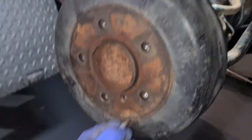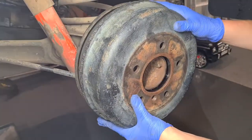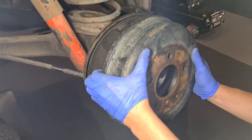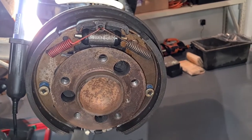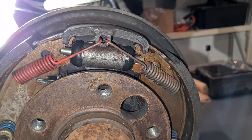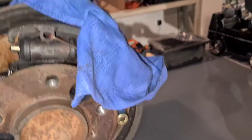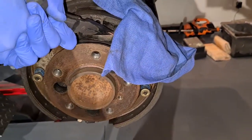The casing comes off with just one screw — needs a bit of a wiggle or sometimes a screwdriver — and off it comes on our 37-year-old G-Wagon. You can see the drum shoes on the outside with the two springs that pull them in. Here I'm pushing the pedal and you can see the left side of the cylinder activates, which would push out against the drum, but the right wasn't working and it was leaking.